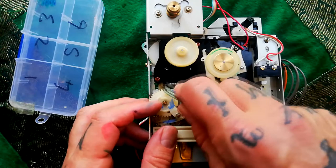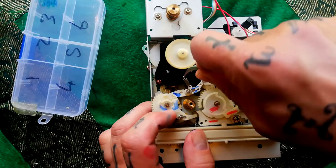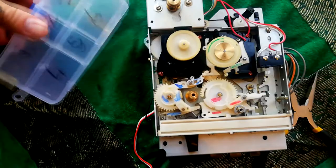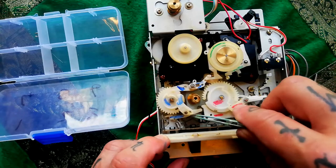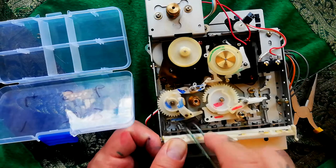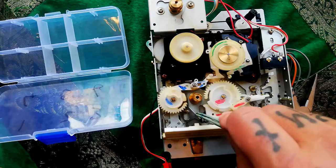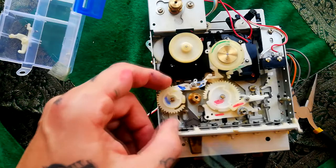You can see there's a spring from this point here to this peg here. I need to remove this e-clip first. This is attached via a spring down on the bottom plate here — first hole from the right. This shaft here, this hole, is where you'd want to clean out with isopropyl and put fresh lubricant on. So that's all going into my compartment one.